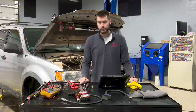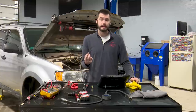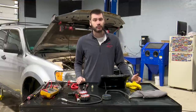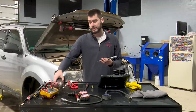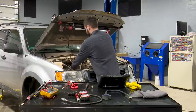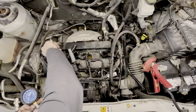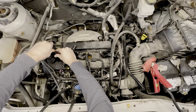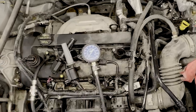What I really want to check is engine mechanical. Swapping coils didn't do anything; the injector circuit is working; the coil circuit is working. I don't want to pull an injector since that takes time and I'd be spilling fuel. Coils come out super easy and spark plugs come out super easy on this engine, so let's throw a compression gauge in and see what it reads. I looked in service information and could not find a compression spec for this engine, so we'll do comparative testing — starting with cylinder one, our problem cylinder, then checking another.